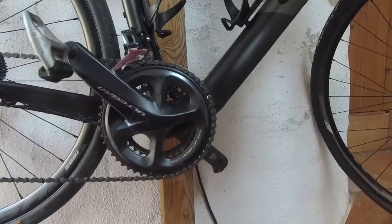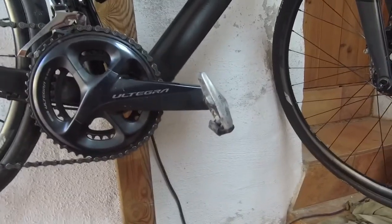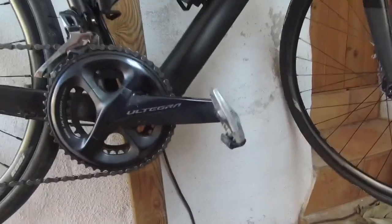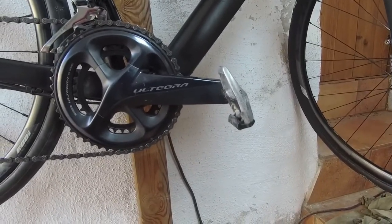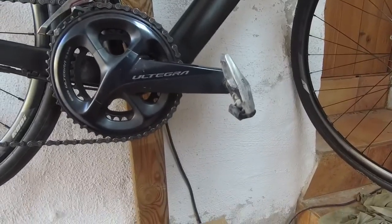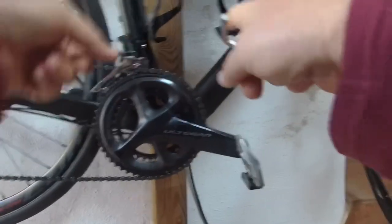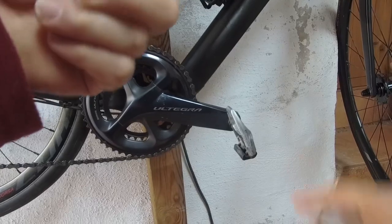So I did think while I'm doing this, I can have a bit of a chat. I'm just going to take the pedals off and put a bit of anti-seize grease on them. I've always used that — other people might say you shouldn't, but I always have. I didn't this time; I was in such a rush I just wanted to go. When you tighten both pedals, if you're looking at the bike facing that way, it's down to tighten and up to release for both pedals. If you put the pedal to the front, it's opposite ways, but the same way if you're looking from one side.